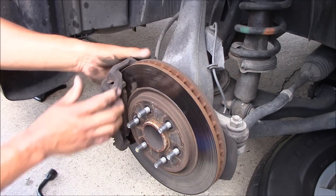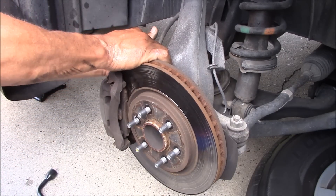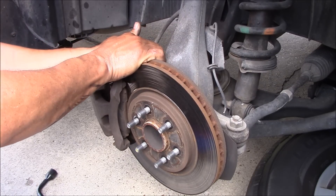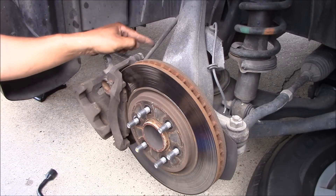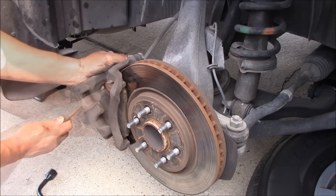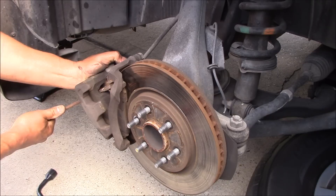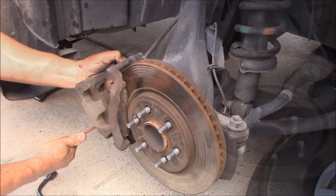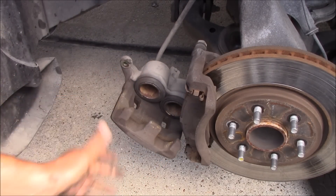So we have this out — loosen it a bit like this. Don't put too much pressure on that hose, so I'm leaving the bolt. Use a screwdriver and push it right in here, that hole right here, and you push your calipers in really slowly. Then you push the bottom one all the way in — you can see I left the bottom screw on.